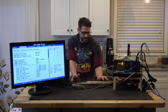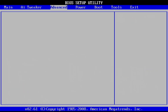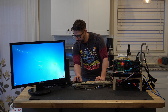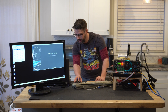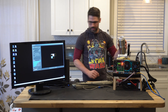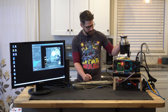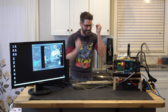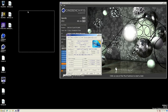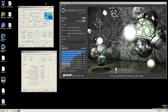We're going to try to hit 480 on on-screen rendering at 527 FSB. We ran out of LN2 — backup flask! We got 481 and didn't crash this time. We need to get CPU-Z tabs open and get the screenshot right. We got 481 confirmed. Since we're already in Windows, let's go ahead and try to run our SuperPi 1.5M. We're running at 4.743 gigahertz.